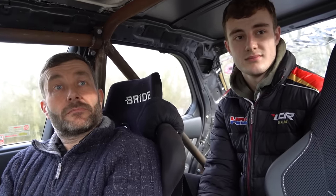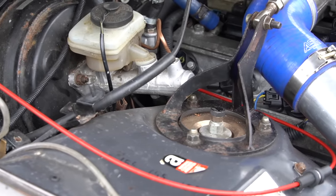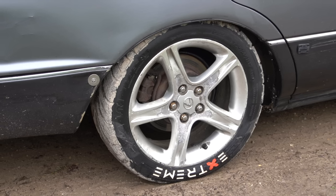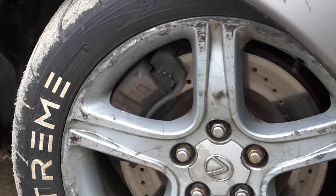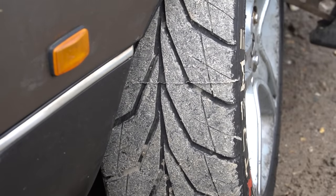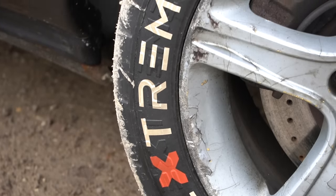On the exterior: the wheels are £40 off eBay — the tyres are £200. It's only on 7J at the moment; we'd love 10s on the rear and 9s on the front but haven't got the budget. For suspension, we couldn't buy coilovers for the car, so we bought second-hand Mark 3 Supra BC Racing coilovers and modified them to fit. The front brakes use Mark 4 Supra oversized discs for £20 off eBay. Today we're running Extreme Tyre V2 semi-slick drift practice tyres.